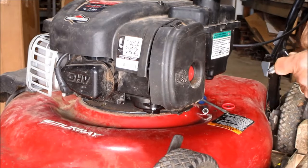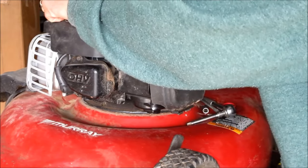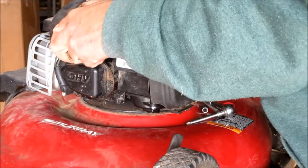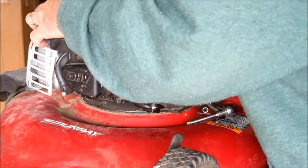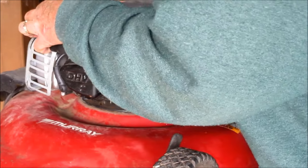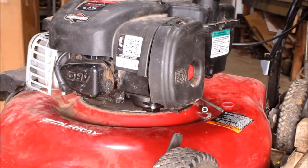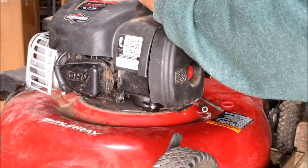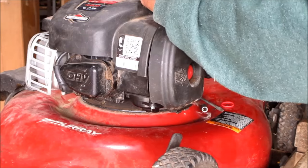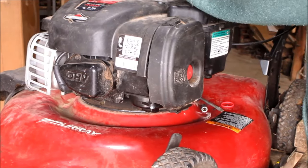Works a lot better if you get you a little socket. Kind of set them down in there to little holes. It's kind of deep on top, so it can be a little tricky getting those screws started, but like I said, get you a ratchet, a socket. You know, put them in by hand so you don't cross thread them. It's only 3 of them.